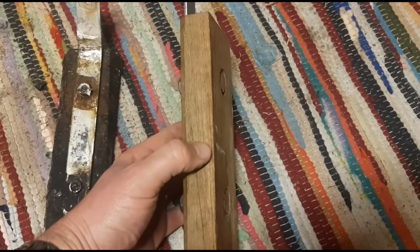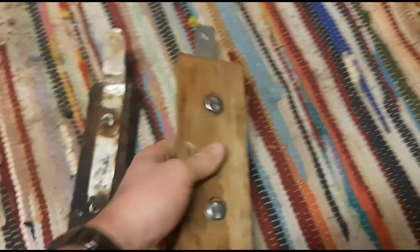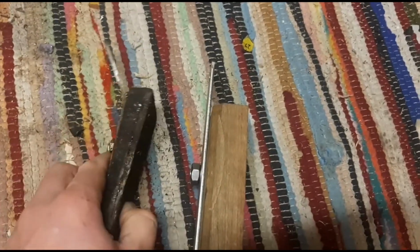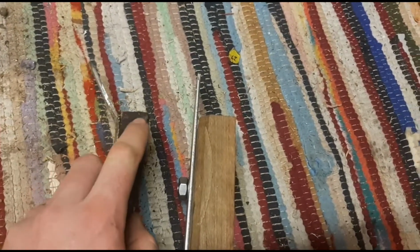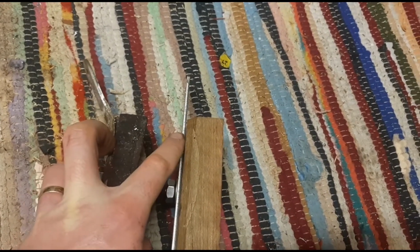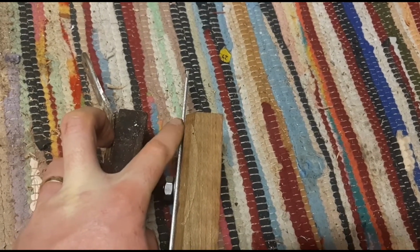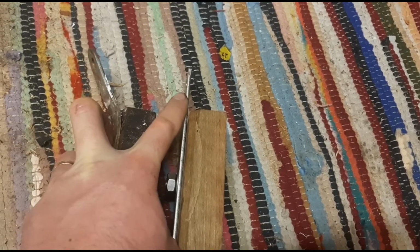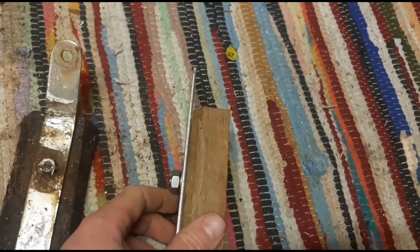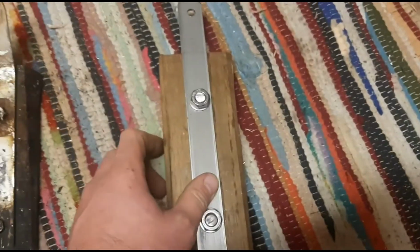I'm actually looking forward to getting these in, but basically what will happen now is go back to the boat, and I'm going to have to cut a new hole in the chain plate, because as you can see, the thickness there is much thinner than the new one. So the position of the chain plate for the deck is going to be slightly more to the centre of the boat, only very slightly, but it is going to mean that I'm not going to be able to use the existing slot. It wasn't my intention to use the existing slot anyway, because I do want to bulk up a little bit with this section of support.